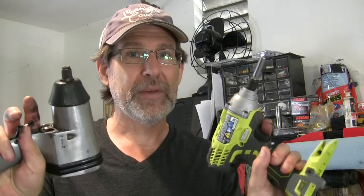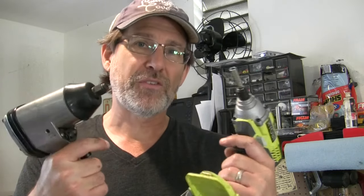Here's another sub-tip. If you have one of these impact wrenches, I'm not really a big fan of recommending these because they put really sharp amounts of torque into whatever you're trying to loosen up. Until that nut gives way, it is hitting and moving the shaft, and that shaft has gears that, even when the bike's in neutral, are engaged with other gears within the transmission. Not necessarily the best way to go. That said, I have done it with success. Do not use either of these with the bike in gear — that's an absolute no-no.